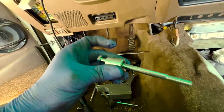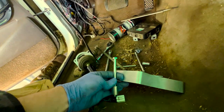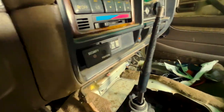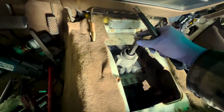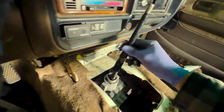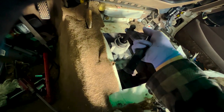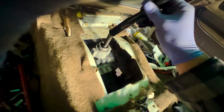These standoffs will go around there like this on the bottom side so that there's something for this to stand on. Now the issue I'm facing is if this isn't in neutral, there's no room to shift into first, third, or fifth. We've removed the Dodge shifter from this casing. This is going to have to be modified to get maybe a 15 to 20 degree angle on here so that we have room to shift forward and make sure we're not contacting our transfer case shifter. I'm going to cut this and try to make a 15 degree angle going like this so I can lean this back a little bit.